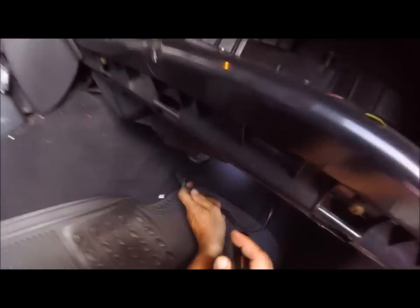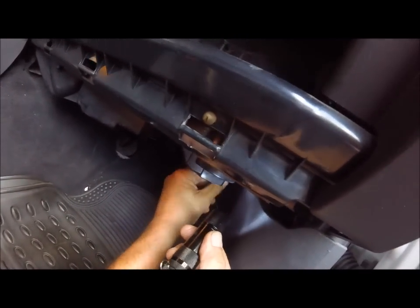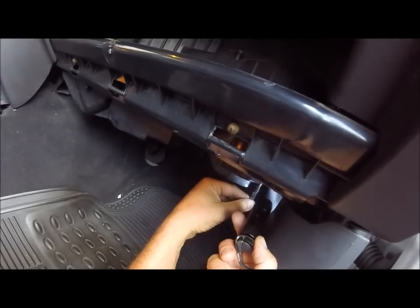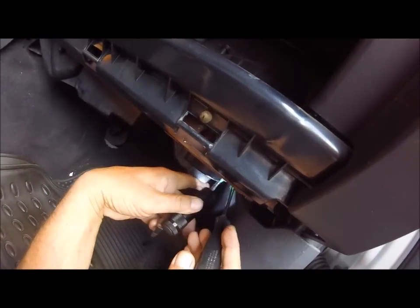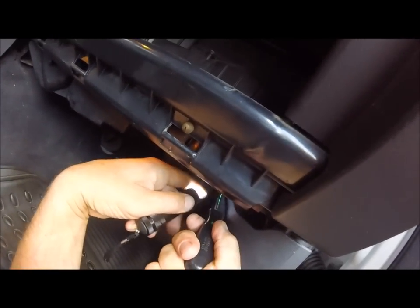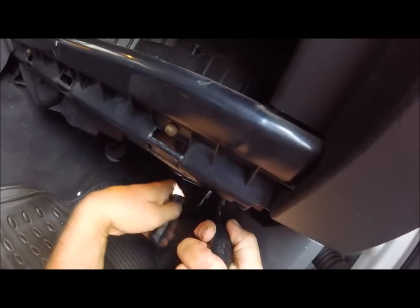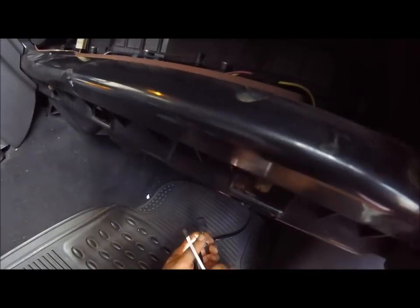You can get right under here and pull this wire up - it's plugged in right under the glove compartment area. I didn't know how to pull the tab so I was struggling a bit. If you don't know where to push it, I was trying from all sides. The solution is to get a longer flat screwdriver, stick it in here and press that tab in to the left, then pull the connector down.